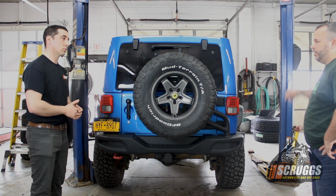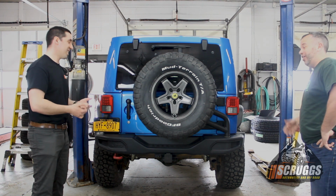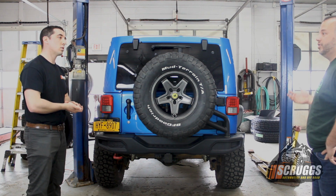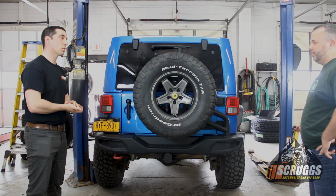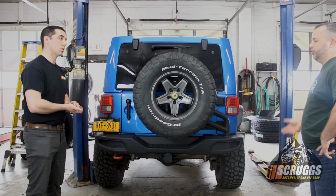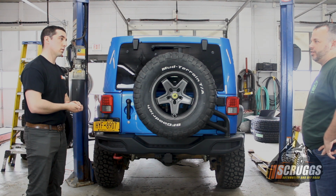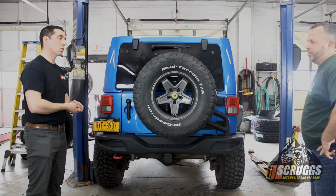well, actually being off-road with the 410s and the 4-to-1 Rock Trac transfer case, you can't go fast enough. I would find that I was wheeling along just on regular roads in 5th and 6th gear just to keep up with people. Wow. And first and second gear it's ridiculous. Like you're rock crawling. You're barely even moving, but it's great when you get to the obstacles. You put it in first, and you just idle along and let it do its thing.